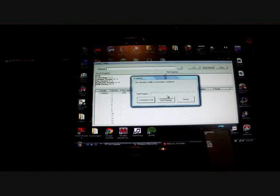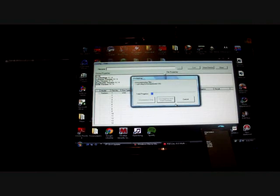you're going to press this uncompress and start flashing in the center. It's the center button here. Press that. And I've done this once before, so it already created the directory. I'm going to overwrite. Just say yes. And this is going to take about a minute. And then it will begin to slowly flash the 15-part file. And it does take about 15 minutes. Make sure that your battery is above 80% before you start this process.